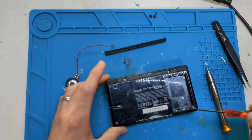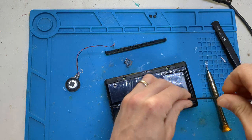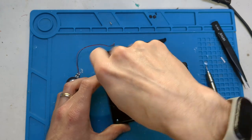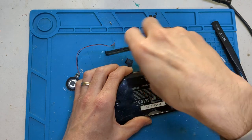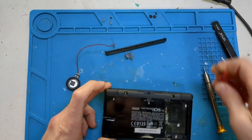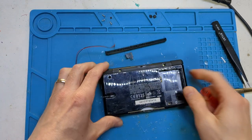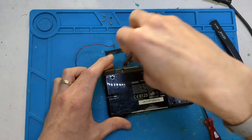Starting with the Tri-Wing screwdriver — there are four Tri-Wing screws. We'll just start undoing these. Nintendo love to use Tri-Wing screws; there are a few units where they don't actually use Tri-Wing screws, noticeably the 2DS — not the XL one, the wedge-shaped one. Keep hold of all these screws. Even if you're going to reshell your DS in this process, I'd suggest keeping the proper screws because they look a lot nicer than the stuff they put in reshell kits.